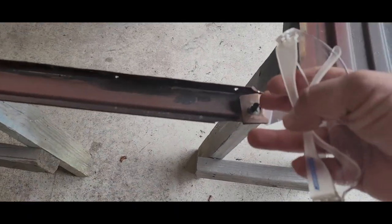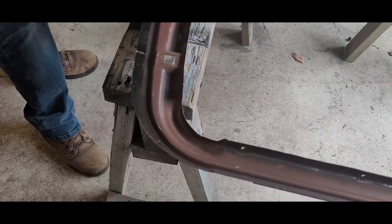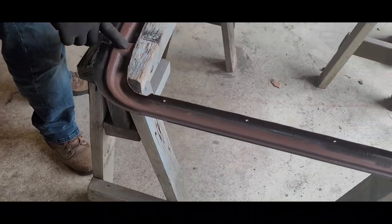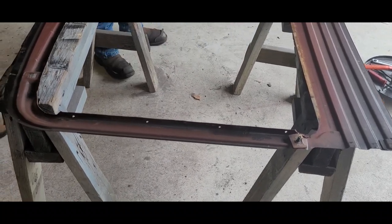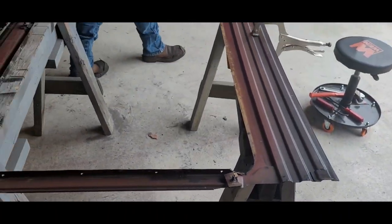So we gotta tack these studs in today before we lose them. Put the other one over there. Yeah. And we lost one. Which is this the one here? We lost one nut. Yeah, so this is going to get welded to the cutout that we make on the car. Should slide right in and then get spot welded in these holes that are drilled. We'll get to that and then we get to the roof.